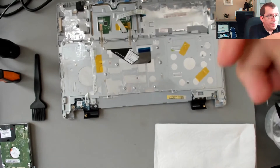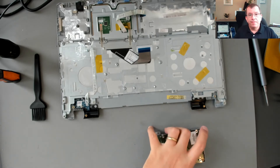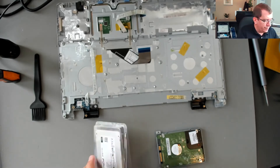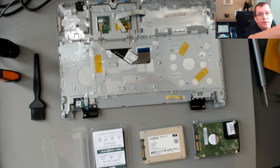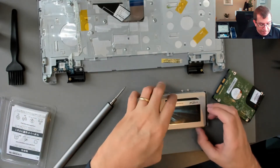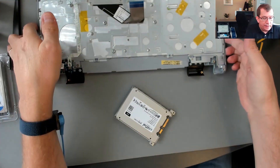I think I may put the computer back together with the new SSD. The owner suggested that rather than going with the cheapest option, we'll put a 500 gigabyte SSD in here, which actually solves one of my problems — I had nearly run out of 250 gigabyte SSDs and I have another laptop that needs one. So the one 250 will go in the other laptop, and this machine will get a 500. It's a thicker drive but once it's in the caddy it'll be supported properly, so it'll be fine. I'm going to put the spacer in there since it's not really supported on all corners. Let me just make sure it lines up. Put this to the side while I let it dry.